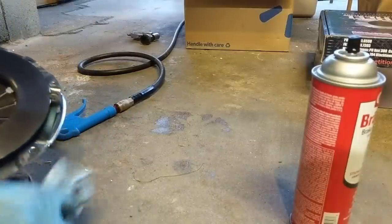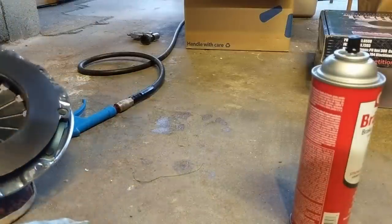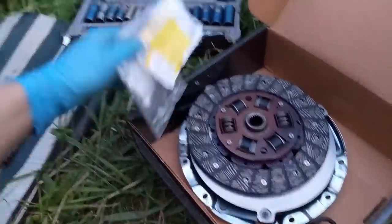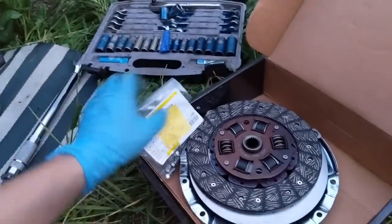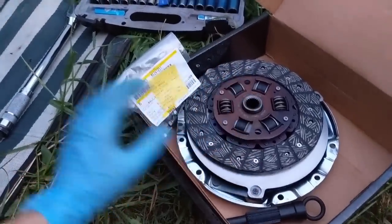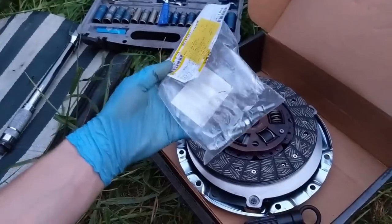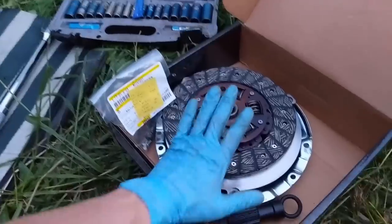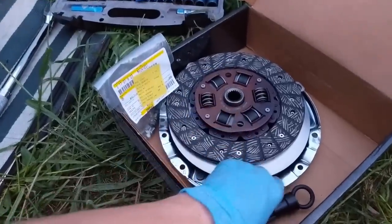Should be good to go. Unfortunately, it is getting dark out, so I won't be putting on the transmission today, but I do have brand new pressure plate bolts, and I have the Exedy racing clutch and pressure plate, and I know that these are supposed to be torqued to 11 to 16 foot-pounds. I'm gonna go for the full 16 because this is an upgraded strength kit, and hopefully that will work out